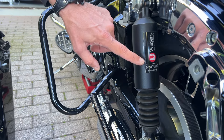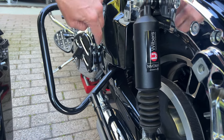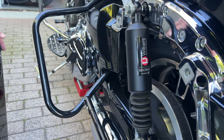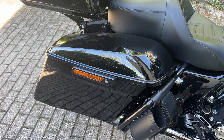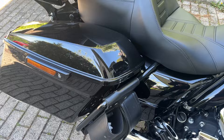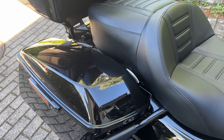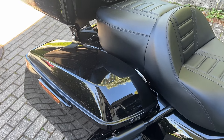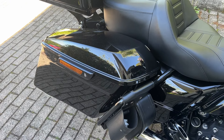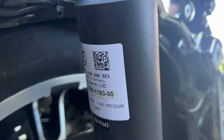The Wilbers sticker — blue or the newer red ones — facing to the rear, and the white one facing to the front. On the white sticker is the serial number of the kit. After checking all the kit numbers and confirming the install is fine, don't forget to check that the 20mm rider sag on the rear had been adjusted correctly. So far on this kit everything was correct.